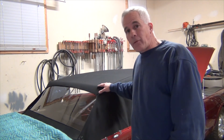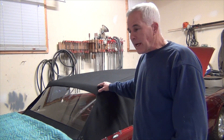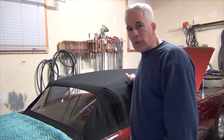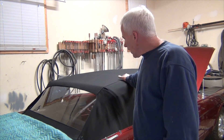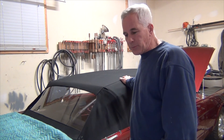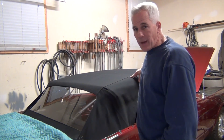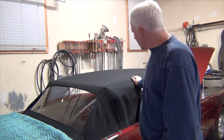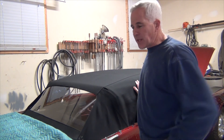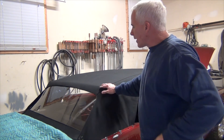I got the webbing installed and that part's pretty straightforward — I haven't had to undo it at all. I didn't connect the webbing to the bows until I was certain that the bows were lining up with the pocket for the bar that's in the top. Then I peeled back the top and set those bows in place by tacking or stapling through the webbing. I didn't use the machine screws — I just abandoned that idea, filled in the space with tack strip and used that. It seemed much easier. After I got that set, I went to work on the window.